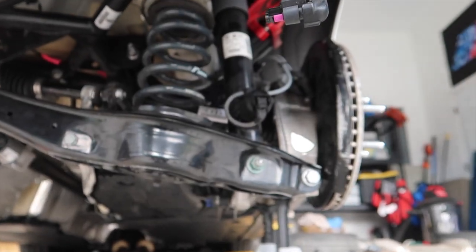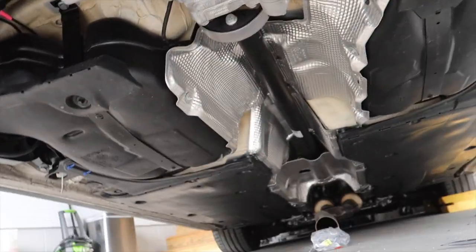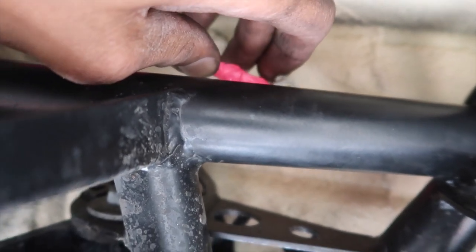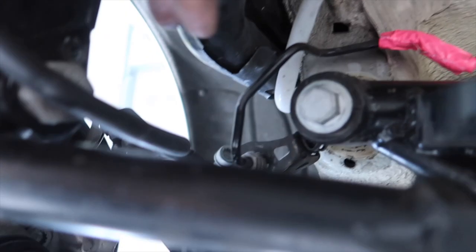If it wasn't so hot and sweaty I'd drink a beer right now because I'm so happy. Pretty much everything's together — only things left are the brakes, the aero covers for the control arms, the exhaust, making sure my studs are tight, and putting the wheels on. The brakes are still hanging, wiring is in, driveshafts connected, level sensor on, Haldex is plugged in. I had to add extra tape to the brake lines — the sleeves that come with the kit I think I left on my Golf R, so duct tape will do for now.